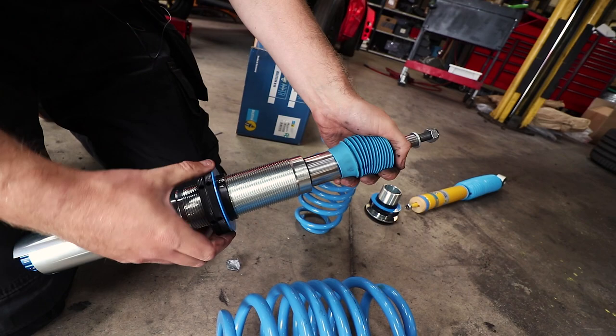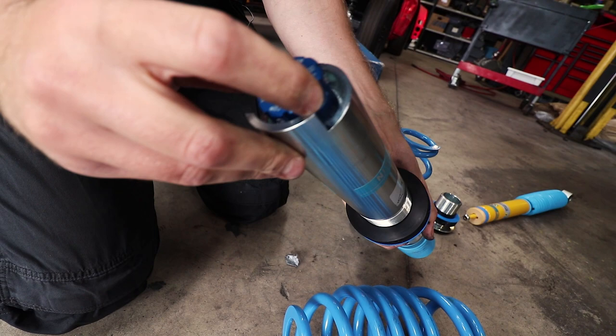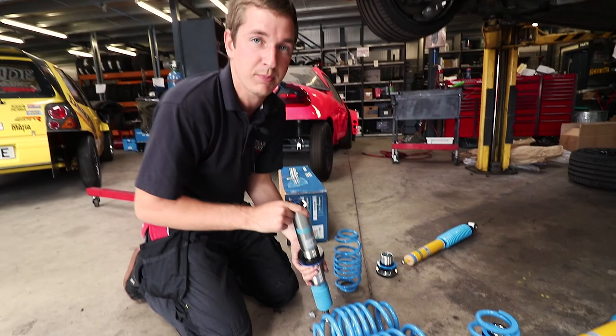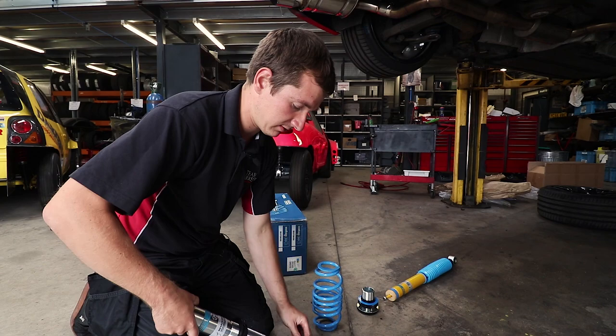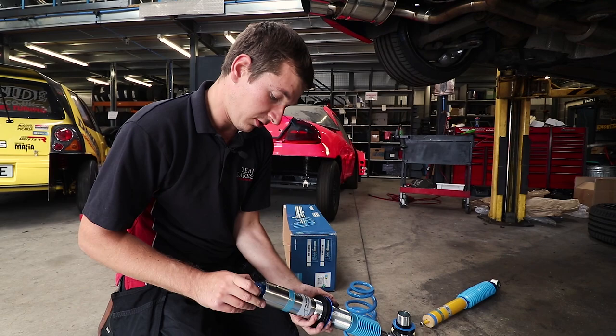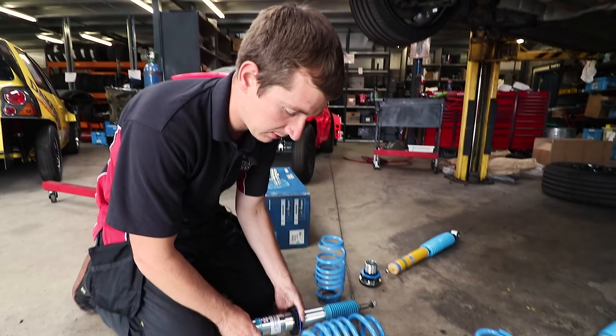And these, yeah, nice big adjuster knob that's easy to see, because what you find with a lot of these type of suspension is it's very hard. They've got 50 point adjustment and usually you're all the way at the top and you're trying to figure out where's best. These, fairly straightforward. What we got was 10 points of adjustment. Nice little indicator on there where we're going to be. These are set at 1. I think we know it's going to be on track. We'll probably set it halfway to start with, number 5.